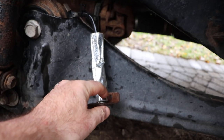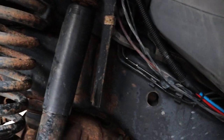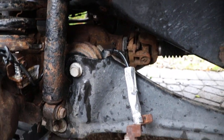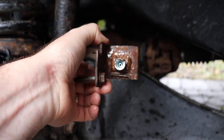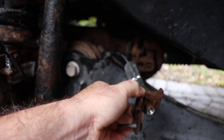There's a little hole in this bracket where your diff breather goes, which you can see hanging out right here — that's your diff breather. I tried all kinds of tools to pop the clip off of here and these things are a pain. I couldn't do it; I was just bending the bracket, so I had to take that bolt out and swing the line down. That seemed to be the best way to do it.